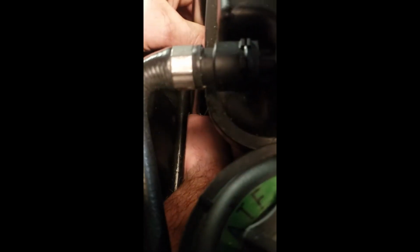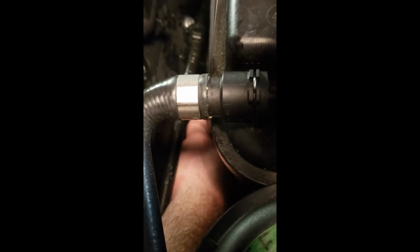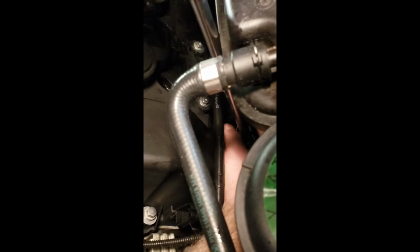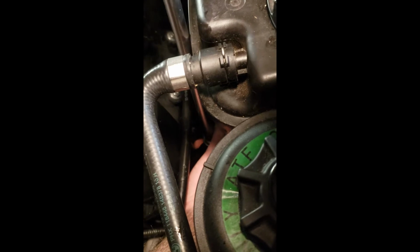Get back down here. Little technical difficulties there, dropping the socket. You don't have to take the panels off the bottom if you're just doing this job. If you can avoid that, that's great. If you do drop something, we had that handy dandy magnet I talked about earlier. But you might have to take your panels off if you're doing a more extensive job, especially if we're talking about the oil thermostat, which is way down under where my hand is, underneath the head by the exhaust manifold. And that's 3 bolts, but you basically have to take the alternator out and a bunch of stuff, go through the wheel well. I didn't film that when I did that job last week.